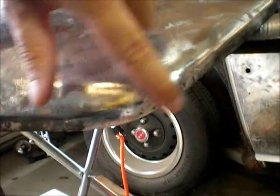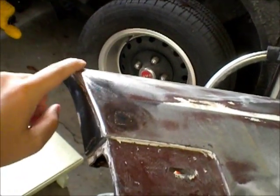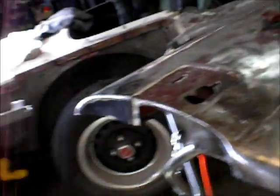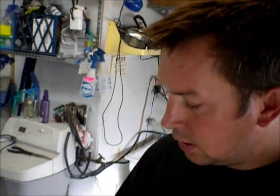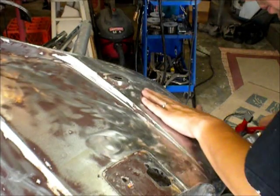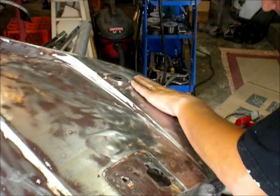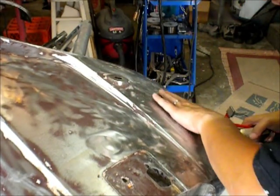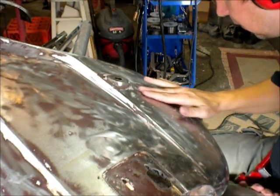I've welded this back together and rebuilt this corner here — it was all rusted out — and finished off these patches. I want to get some metal-to-metal stuff on there so I don't forget where they are later. It's basically done as far as welding. I'm just going to do some hammer and dolly on this part to get the last little bumps out. I'm running my hand to find the low spots, and later I'll use a guide coat or my body file once I feel like I'm getting pretty close.